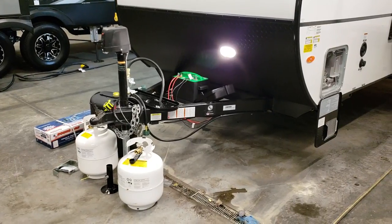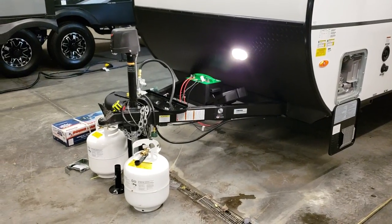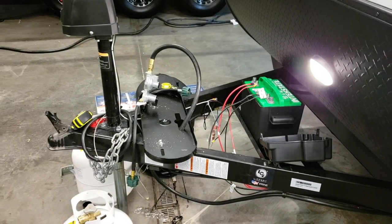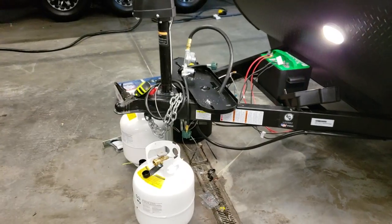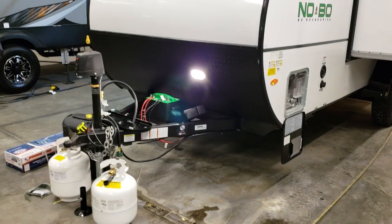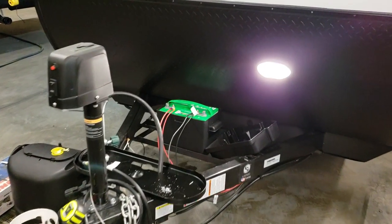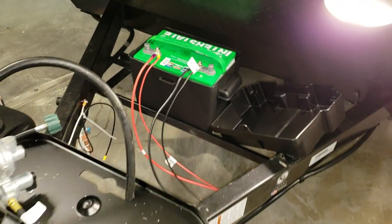You're seeing two gas bottles on the front of this one. The customer is actually choosing to upgrade from the standard single bottle to a dual 20-pound tank system. That requires a new rack, a new regulator, an extra dowel rod mount holder, and a new bottle cover system. That upgrade is available at the store — talk with your salesperson about it. A single battery comes with the unit, provided by the dealership using an Interstate battery, and there is room to do two batteries if you wanted to.